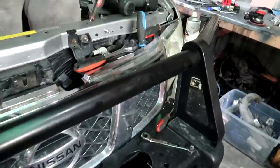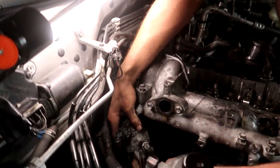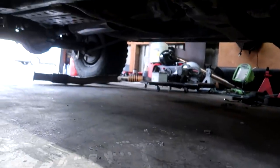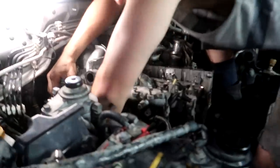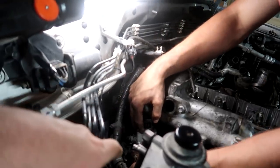Storing everything here. Doesn't look like we've got much movement from unbolting the downpipe from the turbo so I'll go under here and try and do it from this slip join. It's a complete three inch system so hopefully I can take this off and slide it out. Just removing the EGR here because it was in the way - I'll be under here removing the exhaust. Pain in your ass, everything's bloody seized - exhaust nuts are always so shit. Can't be far away now though. I disconnected the EGR but left the pipe just dangling on the rear with the head there.